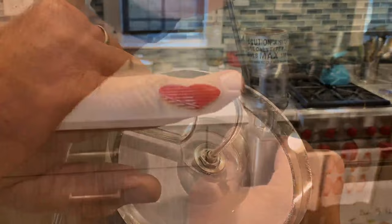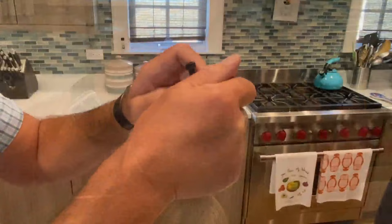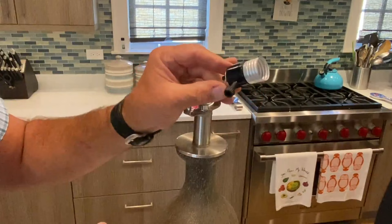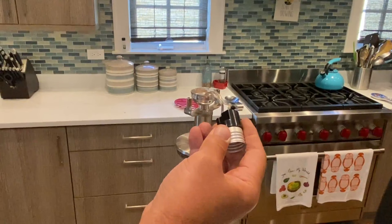Use a screwdriver to separate the housing of the socket, and you pull it out. You see that wire — the lamp cord — comes out. When you pull the top off, that gut portion is what we're going to replace. Remember, this is unplugged. On the guts, there are two different color screws — kind of a gold color and a silver color. That matters because we're going to talk about the lamp cord and how you put it all together.